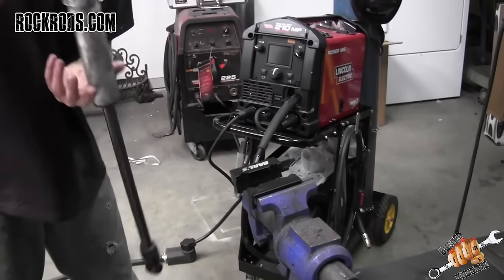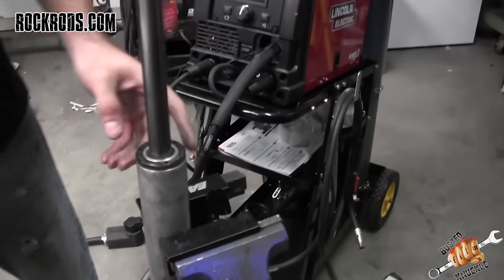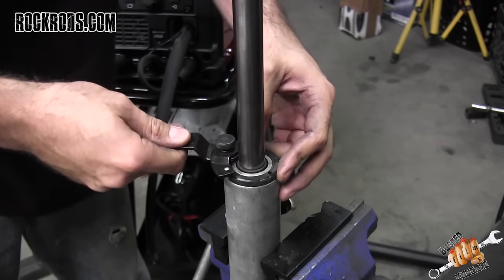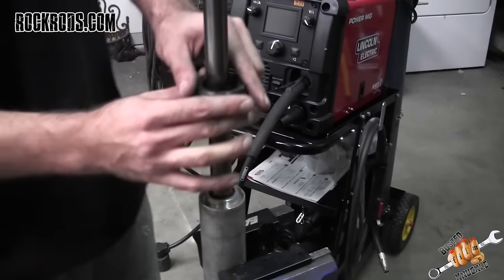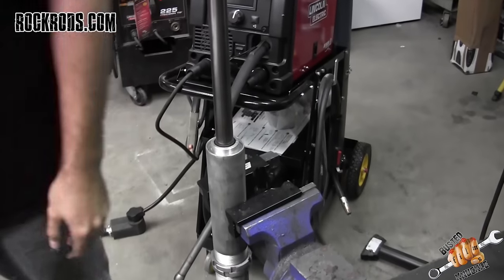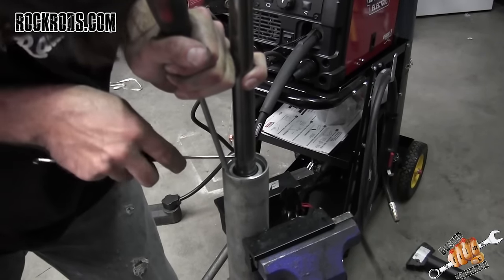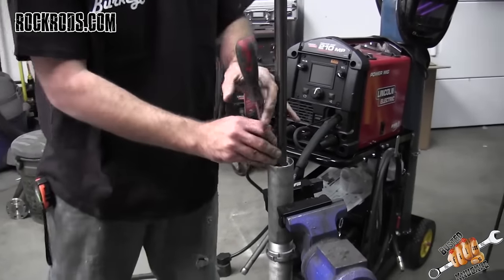Take the shock, flip it back upside down, put it back in your vise, and break this little nut loose with your Allen head. There's a small set screw right here — break that loose and spin it off. That's what keeps the ring from walking off and keeps it locked down. Take your spanner wrench, set it in the recessed holes on the valve keeper. Now that you've got the nitrogen pressure off, push down on the seal housing and remove the snap ring that holds everything in place. Be careful — if there's any pressure left, it will try to blow out and make a mess.